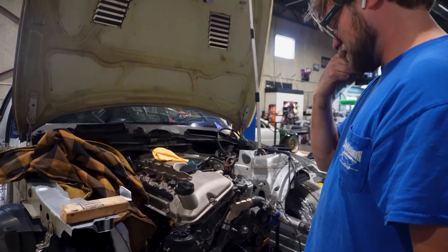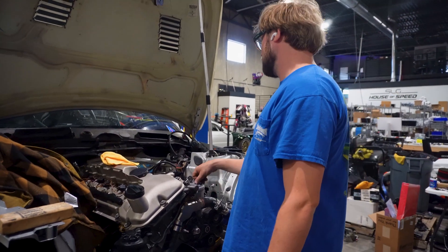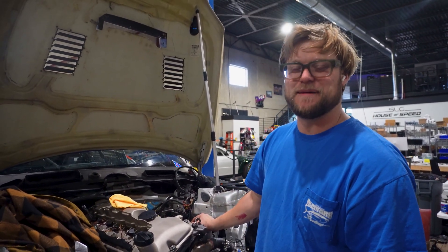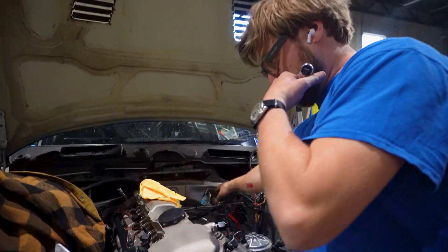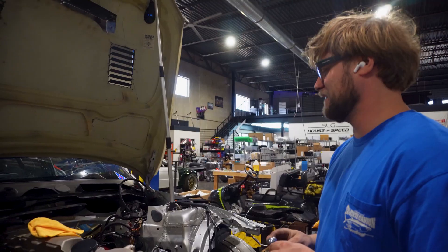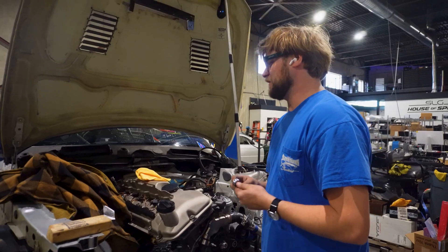That thing's going well. Got the cooler in, kind of got everything set up, all the wiring harness sort of in. So I'm just going to have to go power wash the intake so none of the metal that shot out goes back in the intake. My ITB kit, it kind of hits here really bad. Now is not the time to do all that stuff, so I'm going to put them to the side. With some custom stuff we'll make it work at a later date, but we'll see what it makes with the M50 intake for now.